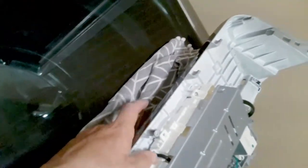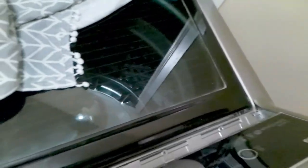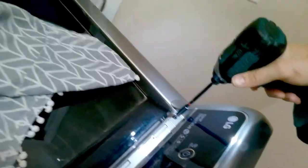Just take your time. It looks like it's easier if you go from the top first — clip the top in, and then you'll clip the bottom in. Realign the display — it just kind of sits into place, it's kind of hard to mess up. Line up the two Phillips head screws, one there, one there. Just snug them — don't over-tighten them with a high-impact drill or you will bust it. Just a light snug. Use a hand tool if you like.